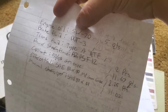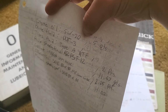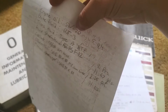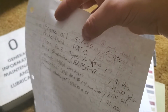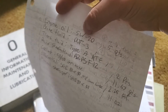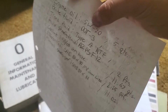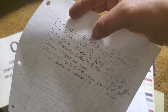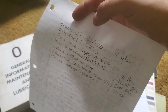So I use conventional straight non-detergent 5W20 because for my car, this is exactly what it came from the factory with. That's probably what I'll run with anyway. But I always choose non-detergent because I don't want to stir up anything in the engine. Really, naturally, you should clean your engine just by changing it. Run the oil in the engine, change your filter, keep going. That's a good way to clean your engine, just by changing out your oil, and sometimes a bit even more frequently, that's fine.